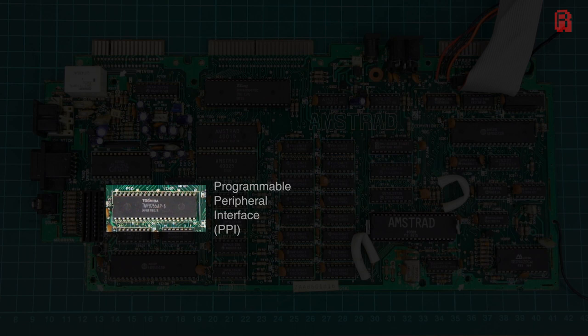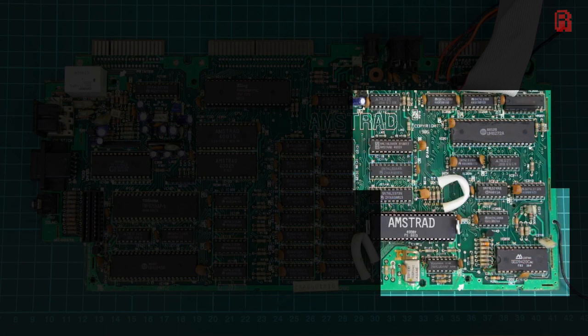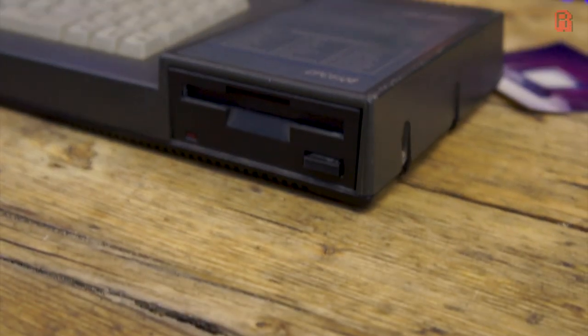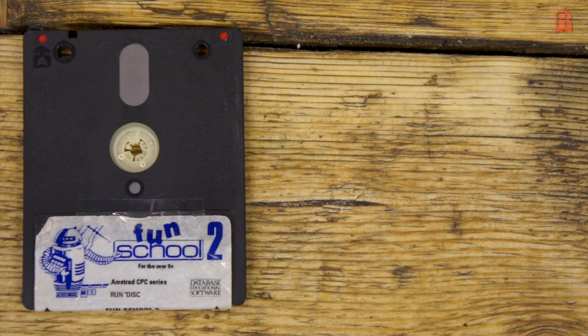We'll also mention some important chips which we're lacking in my 464. In addition to the ROM with disk operations baked in, we also have the data separator and floppy disk controller. When the disk is accessed, there is first a clock pulse which indicates a data bit is coming, followed by a data pulse with that data. The clock pulses keep the disk controller locked on to the stream of data when the speed of the motor and disk drive fluctuates — its speed is not guaranteed. The data separator isolates the clock, and the data pulse is required to perform this task. The floppy disk controller can then get on with the job of accessing the disk with the separator's support.